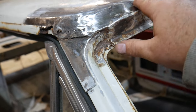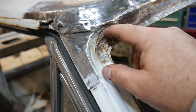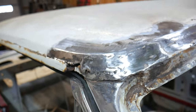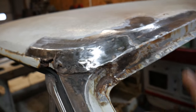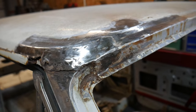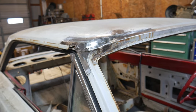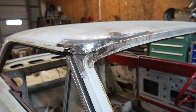It's holding, but they had a lot of body filler in this too. So I'm going to probably cut this section out and try to redo it all and come all the way around. One of the things we're going to try to do is we're going to hook up the CR scan — the CR Ferret — and see if we can scan this corner and maybe make a mold. If nothing else, we can make a mold to form off of hopefully, but I'm going to see if I can make a die and press this thing together. Let's get that set up and try it and see how it works.